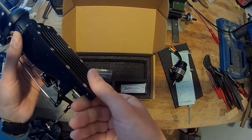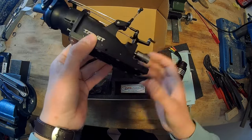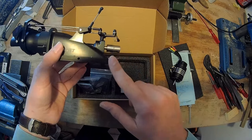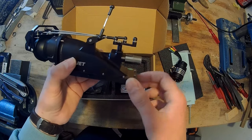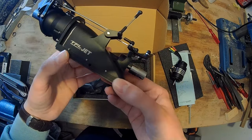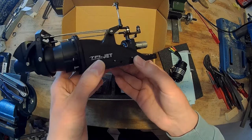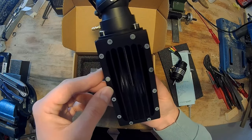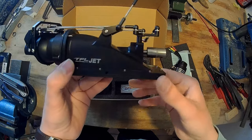Huh, interesting. So apparently these holes where the servo mounts go directly go into the jet inlet. So I think if you screw these screws in, it would make sense to put a little bit of sealing tape on them, so no water gets from the inlet into the hull. It's strange why they didn't close that. I mean, it gives you another mounting option, and it's also easier because you can use all kinds of screws and not only very short ones. But yeah, I don't really like that actually. That's not so cool.